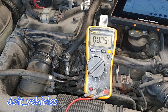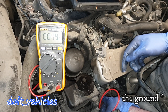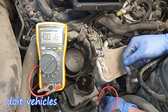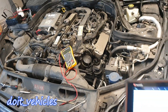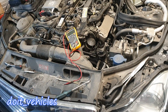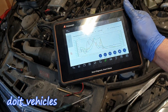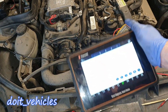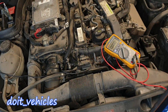Now going to the second sensor. Starting from this side: the first pin — nothing. On the middle one we've got 1 volt. Then on the last one we need to find the 5 volts. When it comes to reading the value from that sensor before the intake manifold, you can use a regular OBD2 scanner. But if you want to see the values from this sensor, you need to go into the Mercedes scanning mode, which you can access from one of these specialized scan tools.